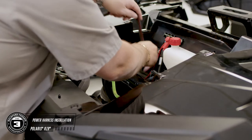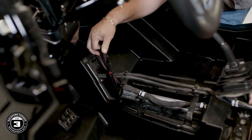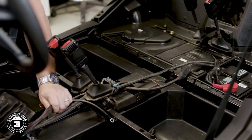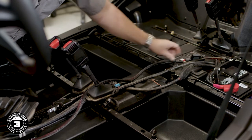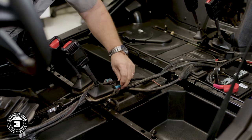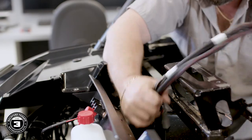Now you're ready to install the main power harness. You're going to run down the radiator compartment, go underneath the floorboard and through the center console, and then back to the battery. It may be a tight squeeze, so if you need to, you can open the waterproof fuse cover for more clearance. Be sure to manage your wiring and do not wrap around any moving parts while routing your cables. Once that's done, we're ready to feed our wiring back through the factory grommet and into the upper dash area. Be sure to leave enough slack up here for any connections that need to be made.